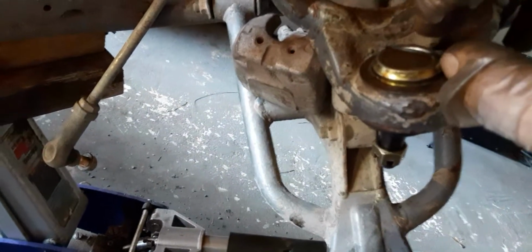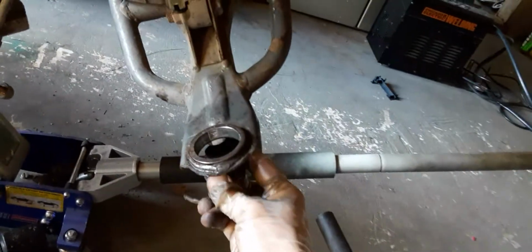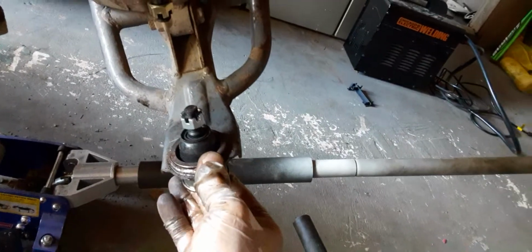And then we're going to put in our snap rings now. So we got the snap ring. I got the other snap ring right here. So now I'm going to proceed with pushing this ball joint through again. And the way I did this one was, if you notice, I got some tie wraps here. I pushed this control arm all the way down and I tie wrap it. Give me 1 second, I'll show you what that looks like.